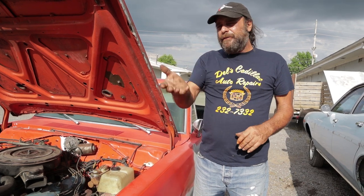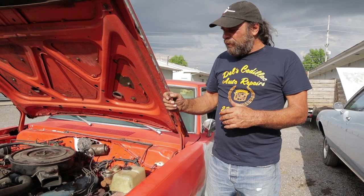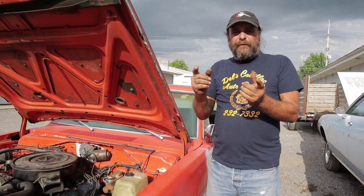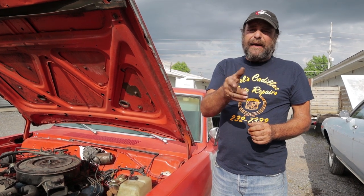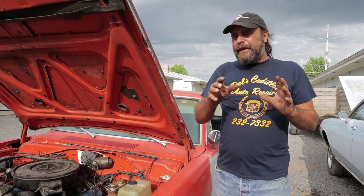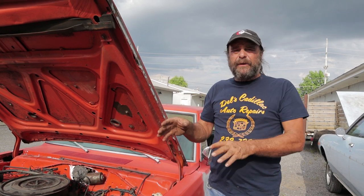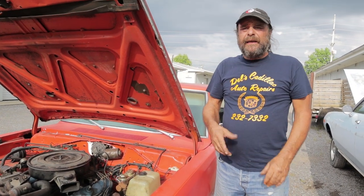Where those problems are, that's for you to figure out — whether it's a bad coil, the point gap has closed up, or the coil wire itself or one of the wires has got a lot of resistance inside. You've got to troubleshoot that, and we'll do a whole video series on that down the road. But that's it — the simple basics. You can't get good results out of anything with these cars until you've got those basics covered.